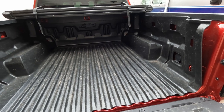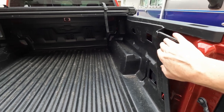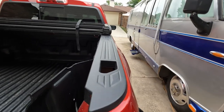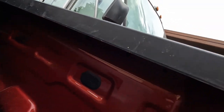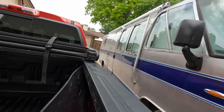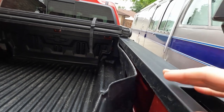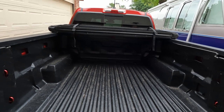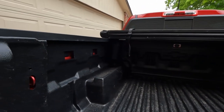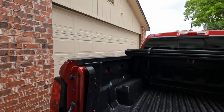The people that have a spray-in bed liner will have an easier time with installation. Now with a removable bed liner like this, we might have to do some cutting because of how it goes up underneath the bed rail. The kit comes with some screws, and in here there are two square holes that accept your fasteners that clip in, and then your light screws into those. The problem is this liner is gonna cover up those screw holes, so we're probably gonna have to notch them out once I get the position. But if you have a spray-in bed liner, you don't have to worry about that. If you do have a drop-in bed liner, there's gonna be a fastener right here — you'll remove that and then this comes out fairly easily. We'll get to that towards the end of the video on what I have to modify.